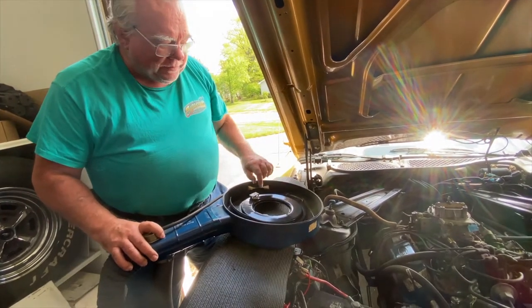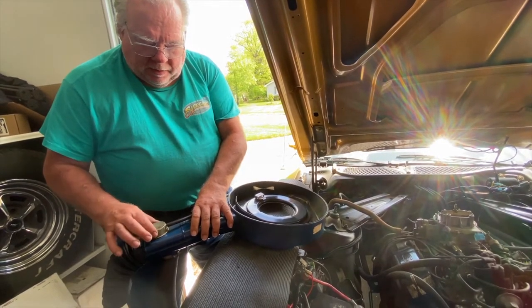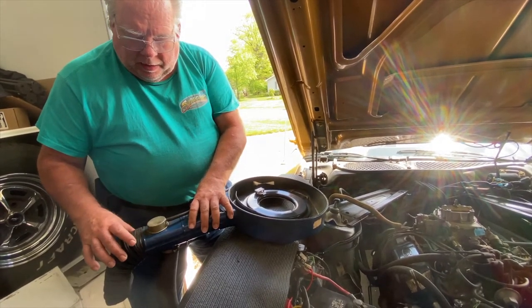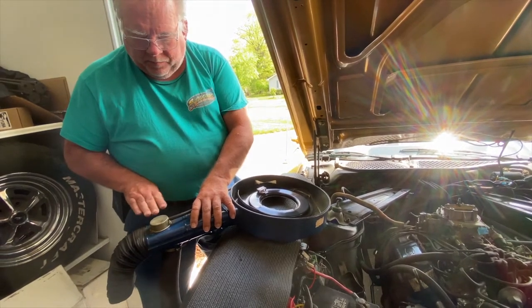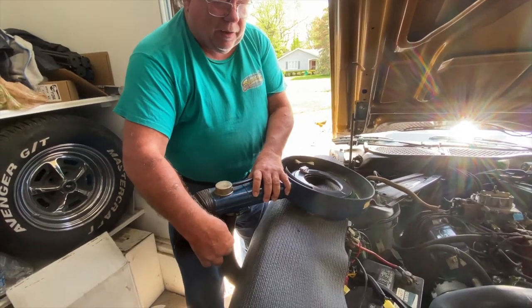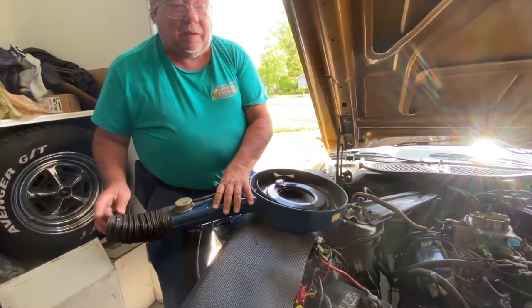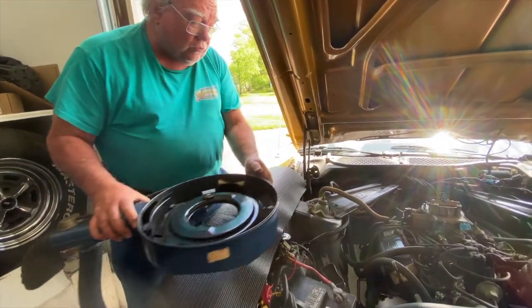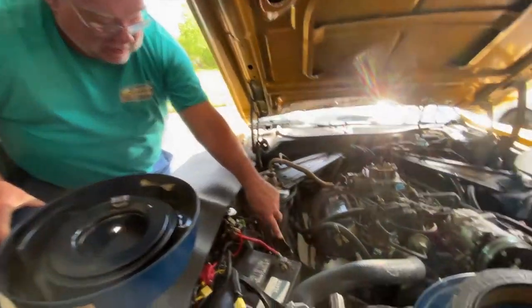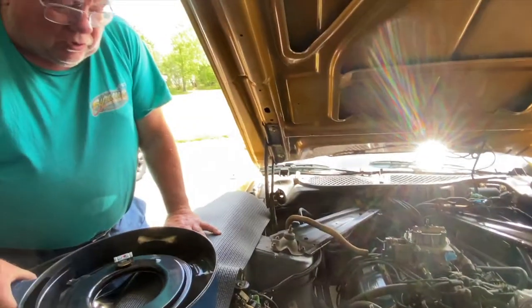As the engine warms up, this will shut off vacuum and cause this door to open inside, directing air from the fresh air side instead of the hot air side. That comes from the fresh air inside of the air filter housing, connected to a little plastic piece rather behind the battery — so you have fresh, relatively cool air coming in. That's what that's all about.